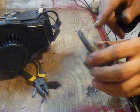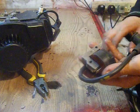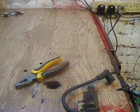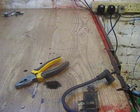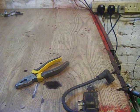But you need to make sure you get this bit here right. Otherwise, if water gets in there, the connections in there will corrode, and so you'll lose spark — even if it's just moisture. Even if it's a foggy day and fog gets into wherever it's stored, like the shed, you can screw it up. Good luck if you try, see you later.